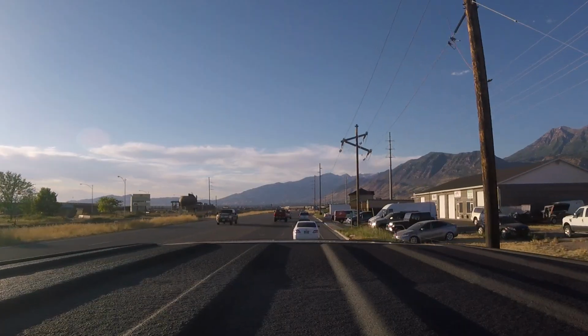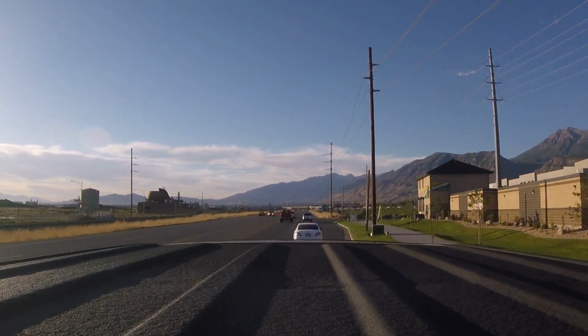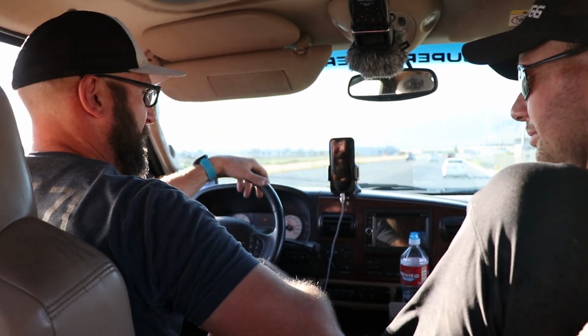Even with the bigger tires lifted and the drive shaft, it's a nice ride. I mean, it's big, it's heavy, it's about 9,000 pounds empty. Okay. So it is fat. Yeah. And it drives like a Ford with a lift. Right. But there's no weirdness introduced because of the stretch. Yeah. And because we boxed the frame, it stiffened it up a lot. So probably stiffer than my original F350, the short bed crew cab. Yeah. Because that whole middle section under the cab is all nice and rigid now.